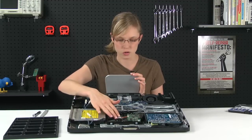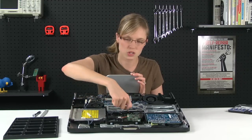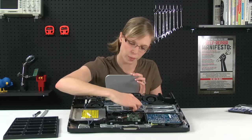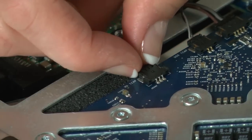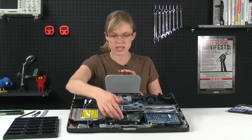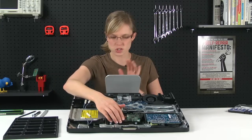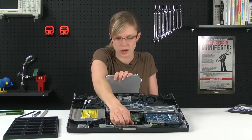Now we can see the hard drive, but before we can remove it, we're going to disconnect its thermal sensor. Don't just yank on the wire — actually grab the connector with your fingernails and pull it out that way, so you don't damage it. Once that's removed, taking out the hard drive does require a bit of force, so maybe brace your hand on the foot and then use the other hand to push down and lift up.